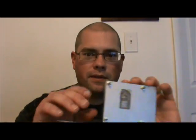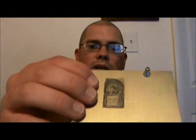Anyhow, the thermal paste that Microsoft uses is important because it's this little stuff right here, and it goes between the processor and the heatsink, and it actually helps to aid in the transmission of heat from the processor to the heatsink, which is essentially a liquid connection to it, but it's not an electroconductive liquid. So it's safe to have on there.